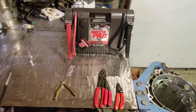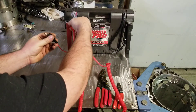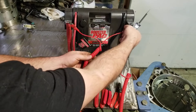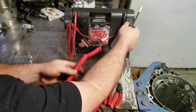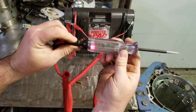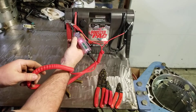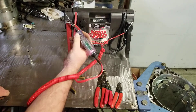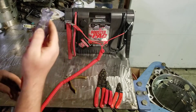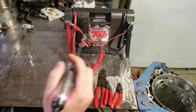As we move up, this is one out of my toolbox. This one will tell you if you have power or ground. With both leads hooked up, the unit shows a red LED light stating we've got a good connection — we've got power and ground. As I touch the lead to power, another red light comes on and says that's 12 volt, that's a positive. If we go to a ground, it turns a green light on saying that's a ground. So if you're trying to test wires in a connector to find out what's power and what's ground, this lets you go through and quickly identify what's what.